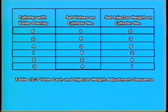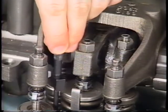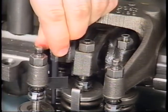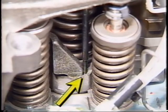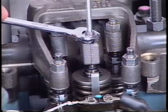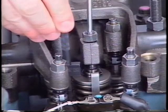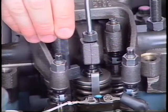Injector height settings and tools are listed in the table. Number thirteen: adjust the fuel injector height for the engine model by placing the small end of the height gauge in the hole provided in the fuel injector body, with the flat of the gauge toward the fuel injector plunger. Number fourteen: loosen the fuel injector rocker arm lock nut and turn the adjusting set screw until the extended part of the gauge with the flag will just pass over the top of the injector follower.